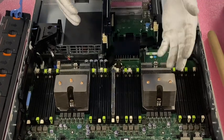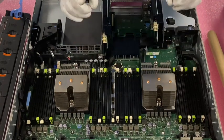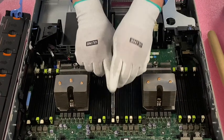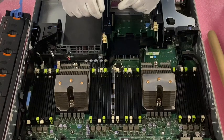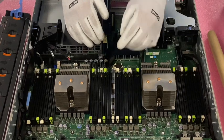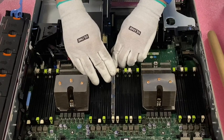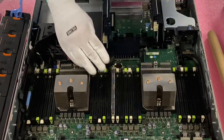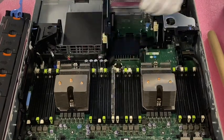We've got it in. Now, this is the next thing I'd like to say — it looks like it's in, but it's actually not fully inserted. This is a very common issue where someone thinks they've inserted a module. You need to hear two clicks. Those two clicks let you know that you have fully inserted the module. Sometimes a module will be sticking out just a little bit, and you won't notice it — so you just have to make sure you hear both clicks.